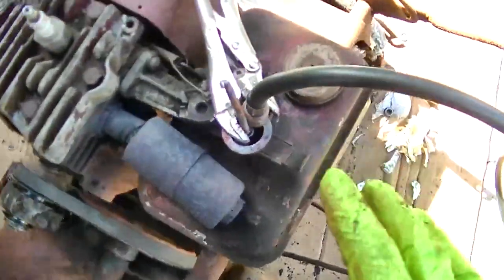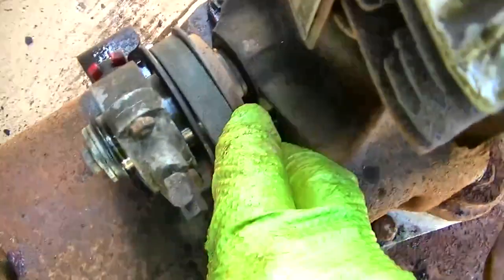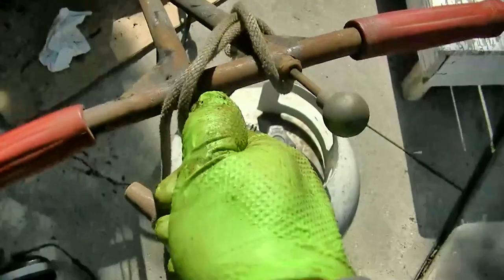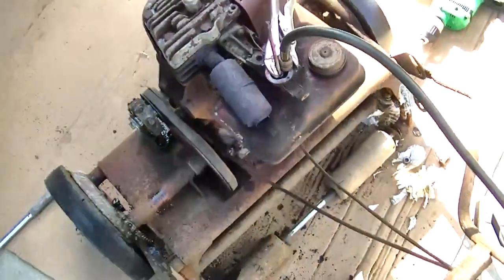I think the next thing to do is to get it actually running on gasoline, because with propane you don't have any real throttle control — you're just at a fixed mixture. I can't believe that belt, probably from 1950, is still good. Getting these to work — how cool is that? These are your controls: that's your throttle and that's your clutch. I think oiling the frozen cables and letting them sit might free them up.